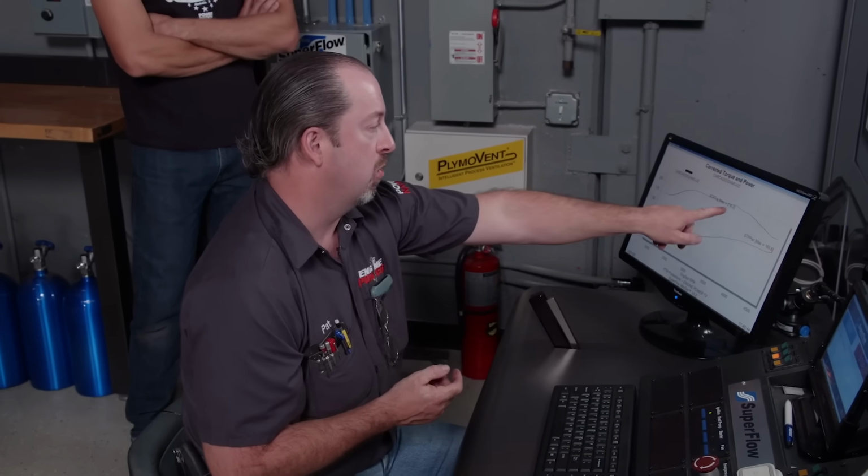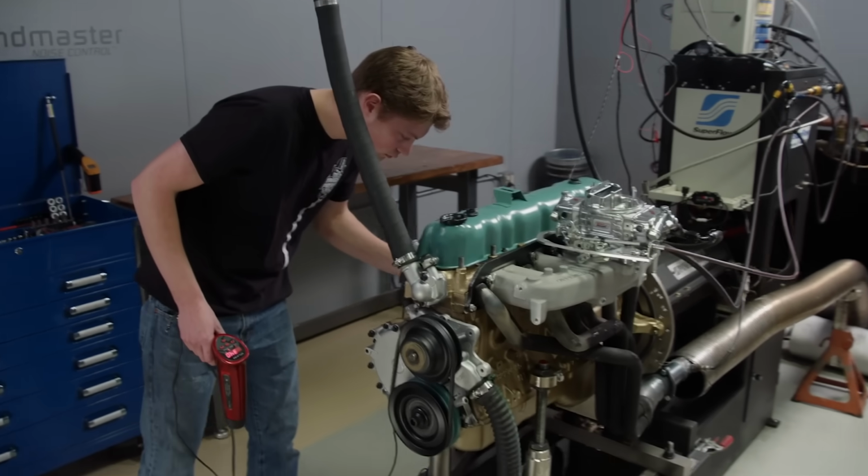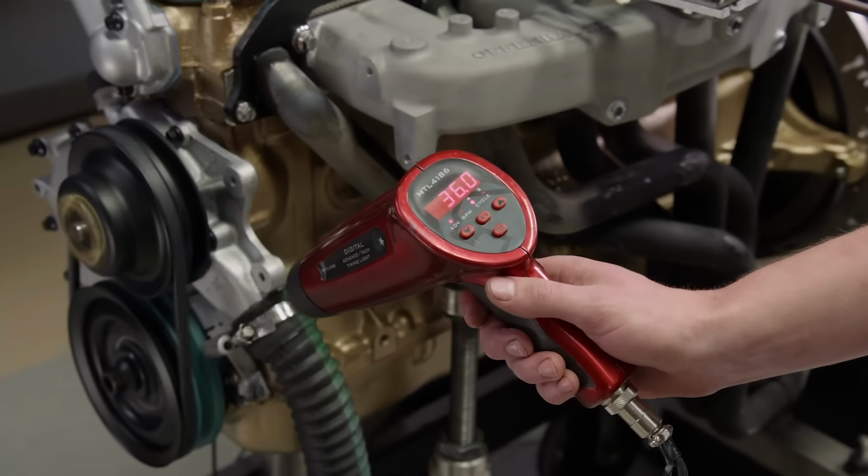Awesome. That's crazy. Oh my goodness gracious. Oh my God, I love doing this stuff. Okay, yeah, you broke the 200 on torque. Yeah, I mean, torque is good. We broke 160 on power, and we're still kind of going up. Since the jump to 34 degrees total timing worked so well, we're going to advance it to 36 degrees total timing for the next run.